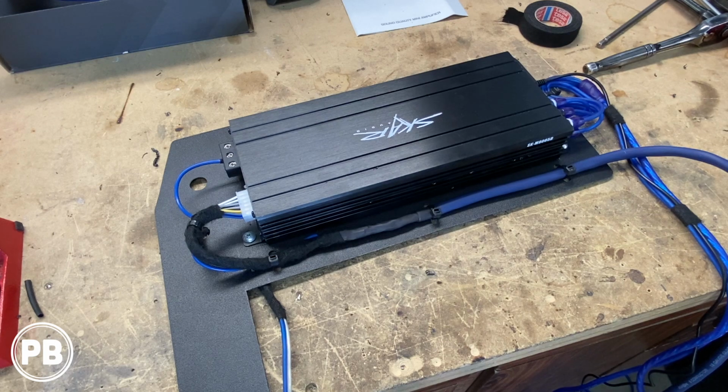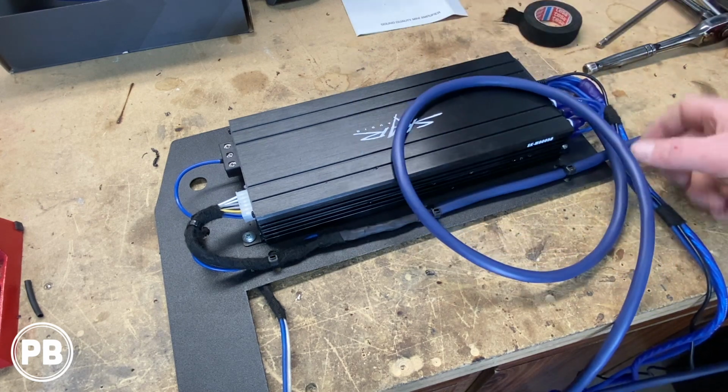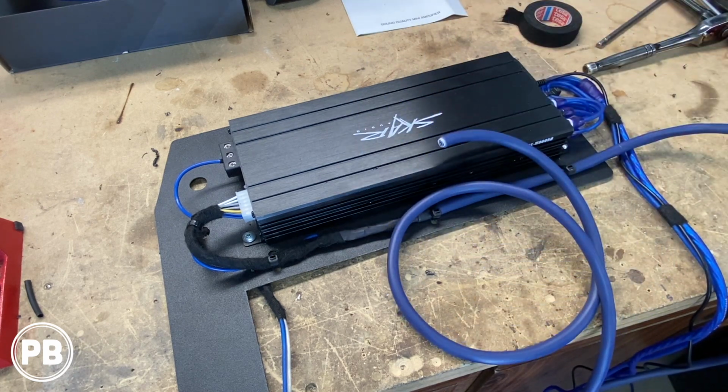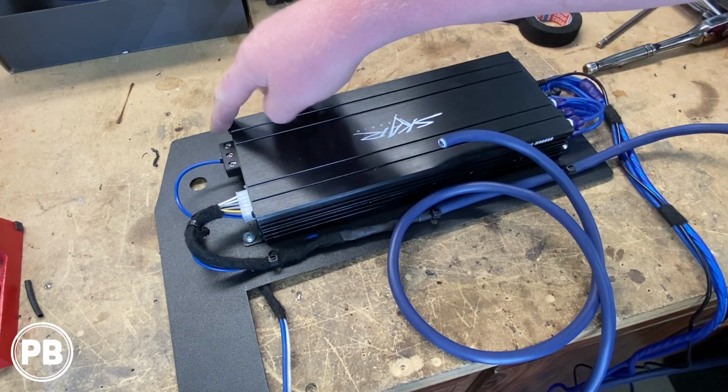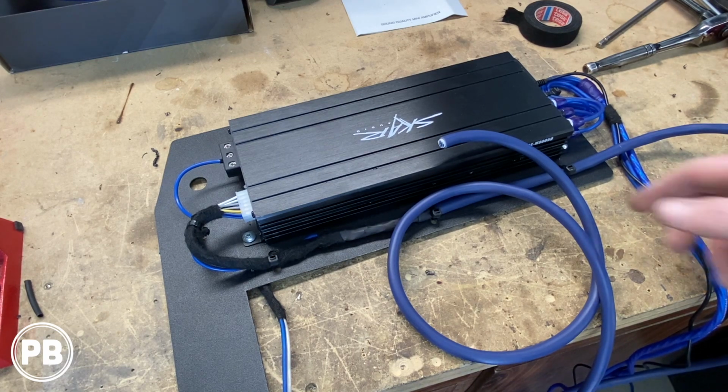Now, it probably is going to be a lot easier for us to solder up the harness end here at the bench versus in the car. So what we're going to do before we even start running power and ground and put the amp rack in the vehicle is let's go pull the radio to go see the condition of the harness and get this prepared.